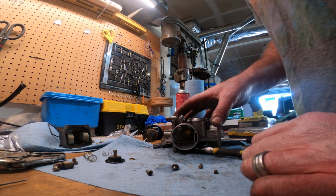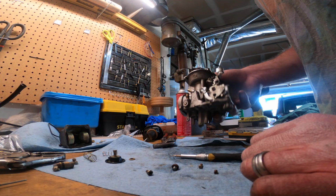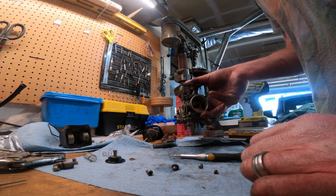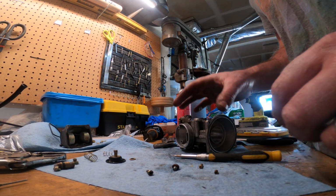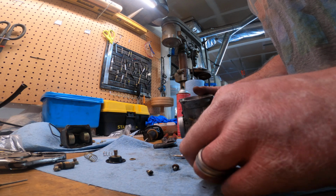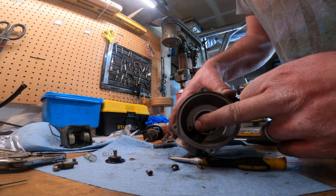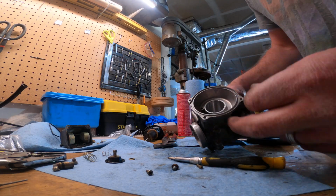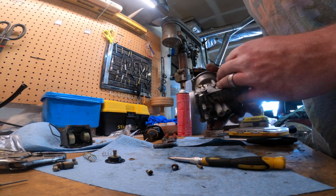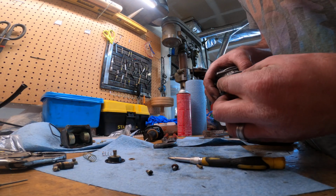Excuse me, then back into the same positions, and those should be fine. I'd like to use all new stuff, but all the important stuff's taken care of, so I'm gonna leave it with that. So this guy goes back. So there was one in here I pulled out. I didn't show you, but that's a pretty wide orifice on that jet. And then the other one I got to put back on is this little tiny guy that came out of here.